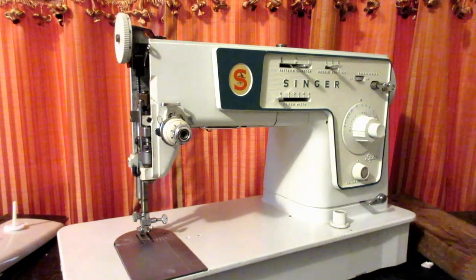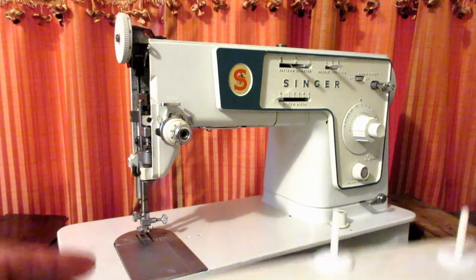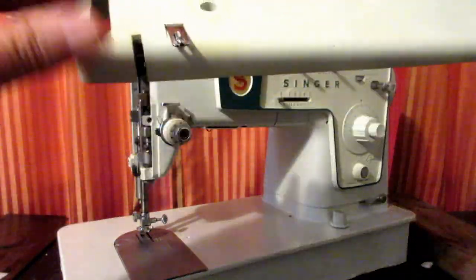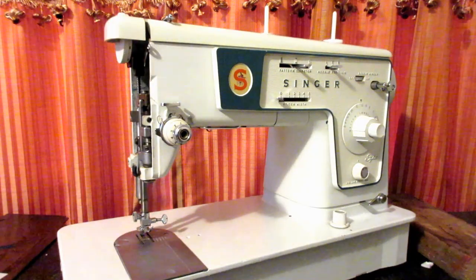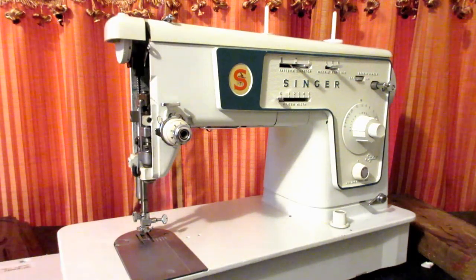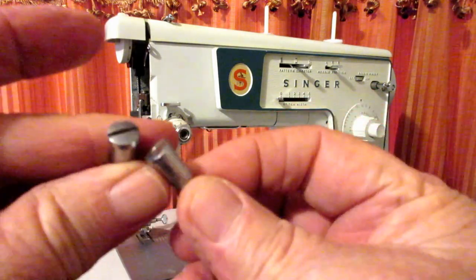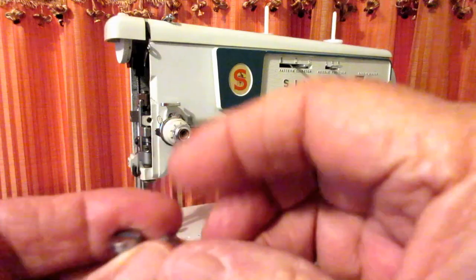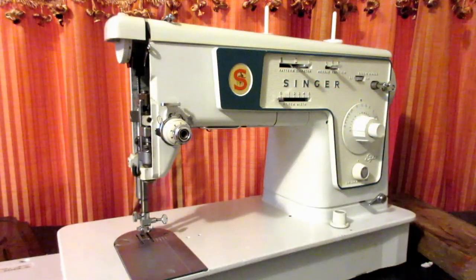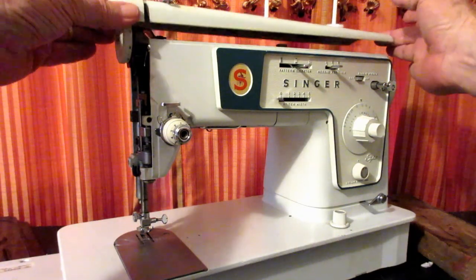Okay. Then I go up to the arm cover up on the top here, and it just sits over the pressure dial like that. It's got two kind of hefty top screws, I call them, one towards the front, one back by the hand wheel. Remove those screws, and then this arm cover will lift straight up and off, just like that. Okay.